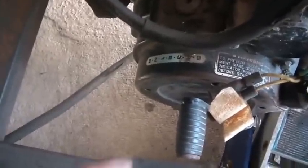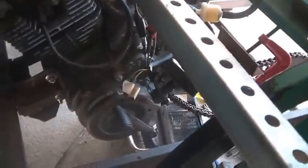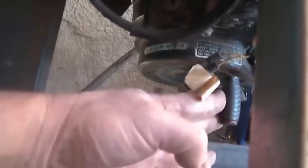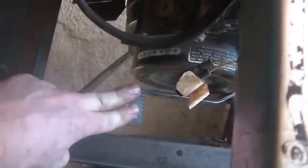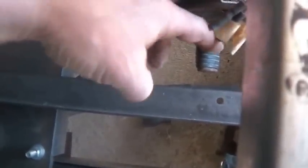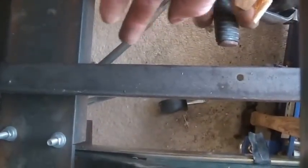Shifting. You noticed I cocked the shift lever up a little bit, right? You can see it should be down where this thing is, and it's up. And quite honestly, that just put it in gear. That takes it out of gear. And if I had the thing depressed, it would actually put it in neutral. So it's as easy as having, you know, 2 forks on a bar, pushing this back and forth,